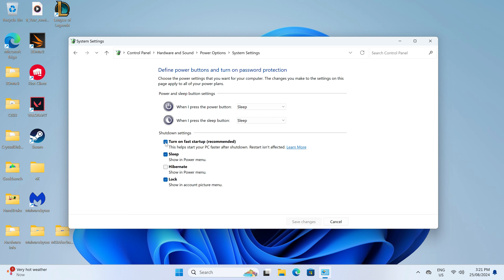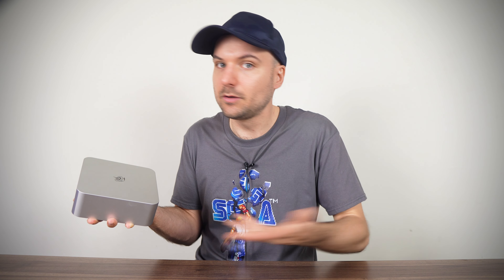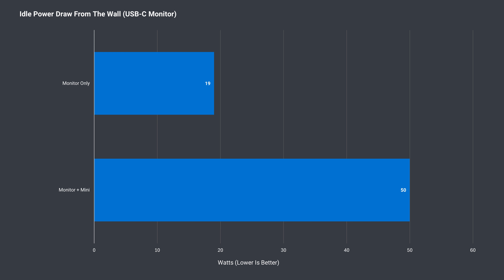So that's the power draw when it's shut off — but how about when it's idling in Windows doing nothing at all? Well, 31 watts when idle — more than double the worst result in this stack, which is the B-Link SA14. So I hooked up my USB-C monitor, and at idle it chugged 50 watts. The monitor by itself only takes 19 — that's 31 watts again. So it's not the inbuilt power supply, maybe the board, and I don't know if this can be fixed with a BIOS update.